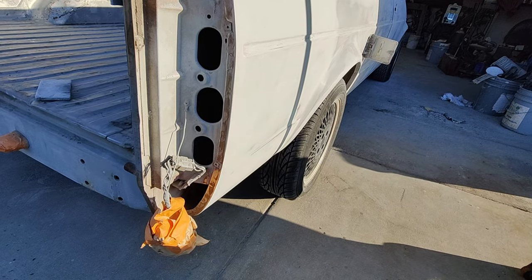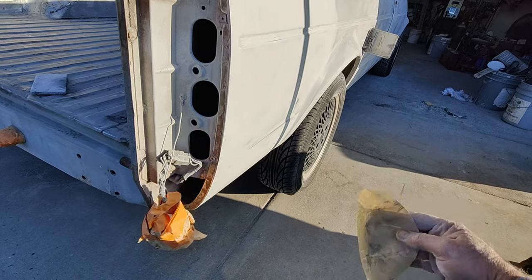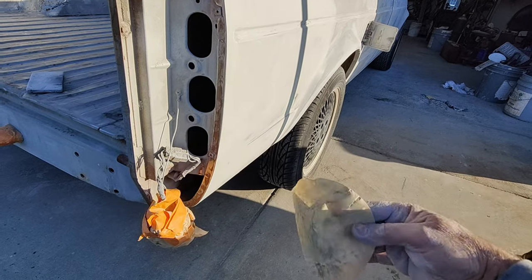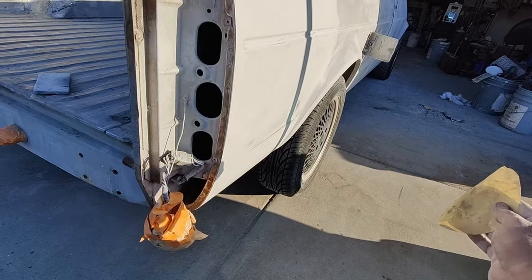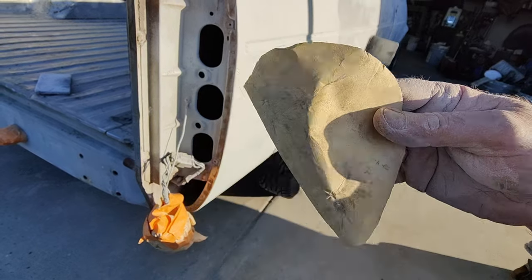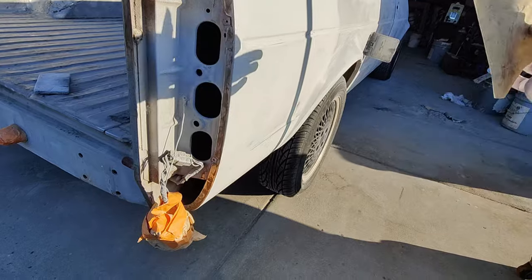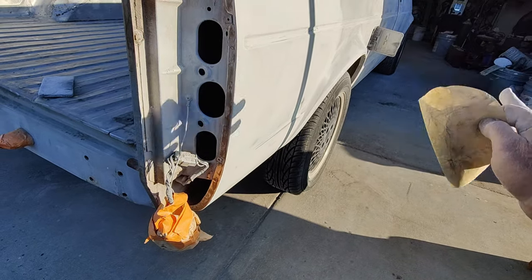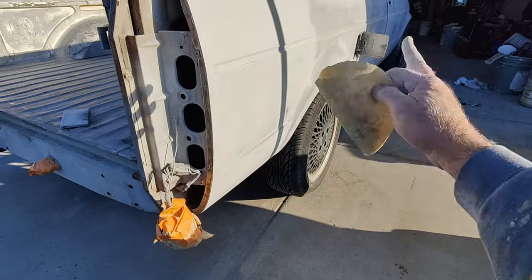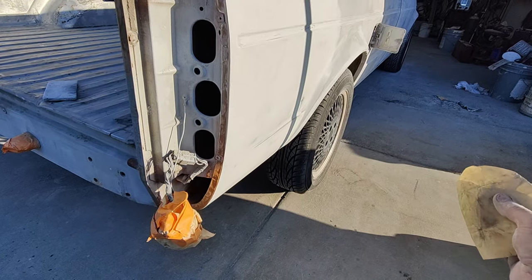Shoot on one regular coat, and then I'll shoot on a really dry one. In fact, my first coat is not going to be very heavy, just a nice light coat, and then I'll do a double drop coat on it, where I'll be further away and just kind of dust her. Maybe I'll cross spray it or something like that. I don't know. It all depends on how the silver lays down and how I get it on. It depends on the spray gun I'm using.